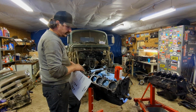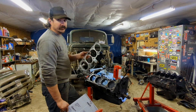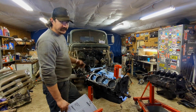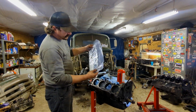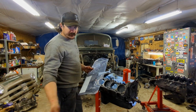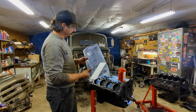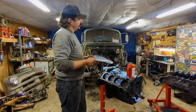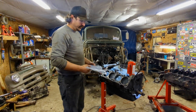Now to the stuff that matters. These Magnums — the head gaskets. This is a Felpro stock-style one; I ran these and they'll blow at eight pounds, guaranteed. The stock ones actually seemed to run a little better. These 1008s supposedly were better but didn't really do any better. What you need are the Cometic MLS gaskets — multi-layer, three layers of steel. But these need a pretty much perfect surface to seal. According to the box they want a surface finish of 50 Ra, which means you should have the block decked at a machine shop.